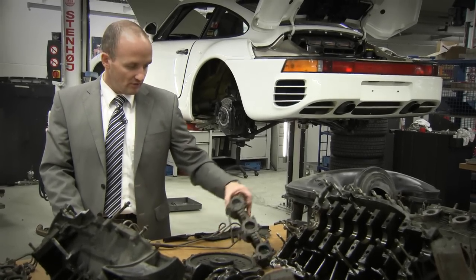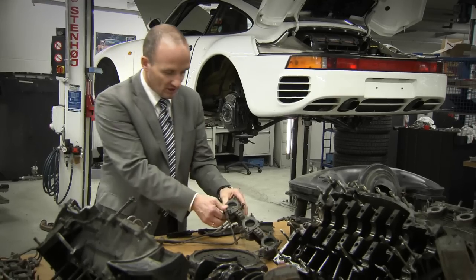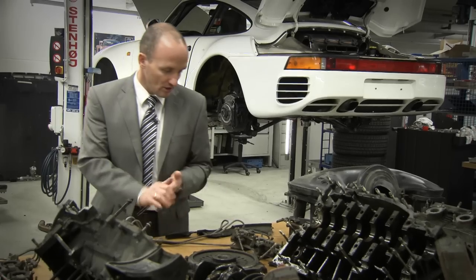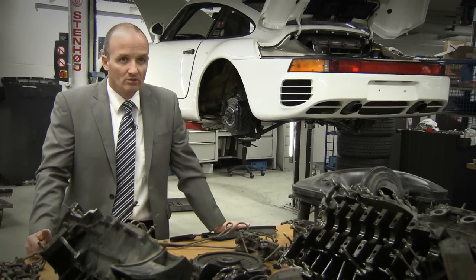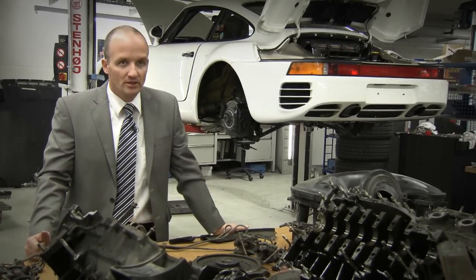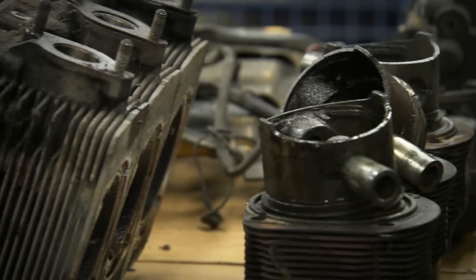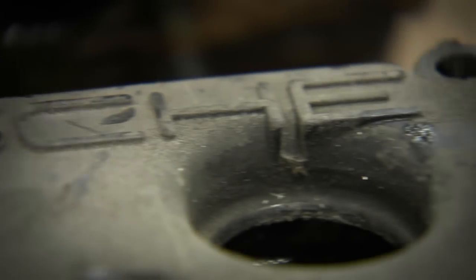Some parts, such as a throttle body, for example, are no longer available, so they have to be completely overhauled. New throttle valves are installed, the bores are cleaned up, recoated, and then they're as good as new. This mint-condition 140 horsepower engine, coupled with the air-cooled Porsche flat engine sound, will give the Revive the Passion winner pleasure for years to come.